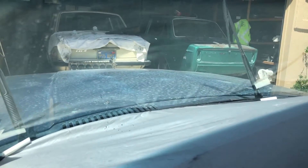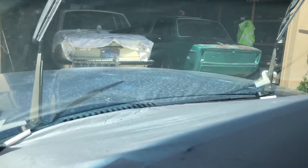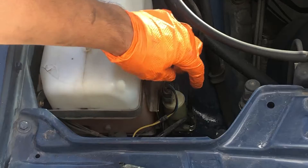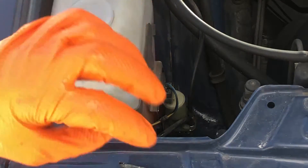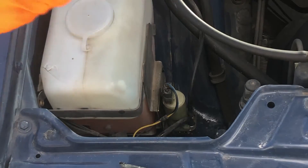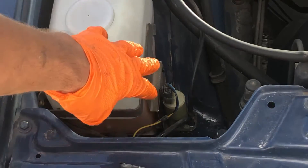The lines really need a good flush and the nozzles are pretty stuck. With the outlet hose disconnected: if water is just dripping out, the pump has some flow but may still need cleaning; if nothing is coming out of the outlet like mine, the pump itself is what's dirty. Now that everything is back together, let's see how it does.